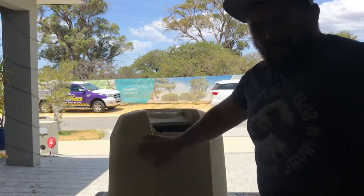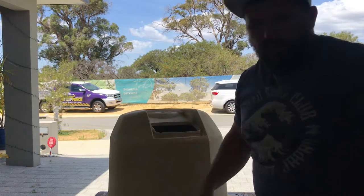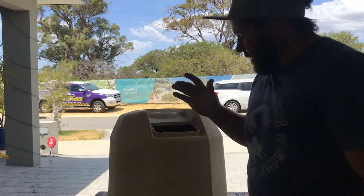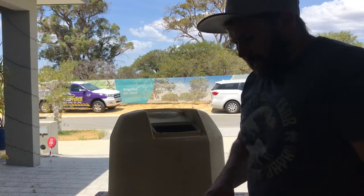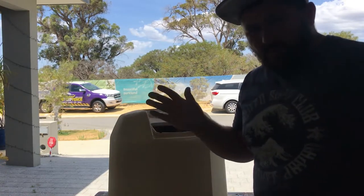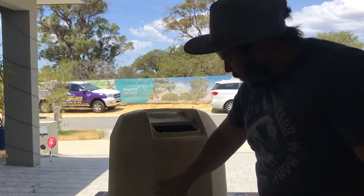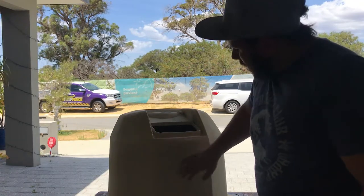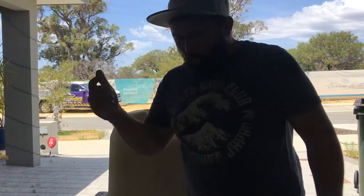What I've done is put a 180 grit on the triangle sander, just to make it a bit easier because I have to hand sand this. I can't use an orbital sander because it's too aggressive. The triangular sander is probably the best because it just vibrates instead of spinning like an orbital. I'll hand sand the rest with 180 until it's all nice and smooth.